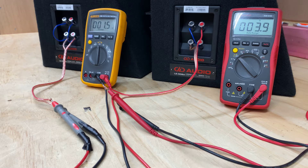I thought it was a handy way to do it so you can actually see how it's wired. Some people have many questions about how to do this, but we really haven't had to worry about it because in the pre-made segment they'd always been wired directly to a 1 ohm load, and you would then go to your installer to change it. So today we've just covered off how to do it. Again, the red multimeter gives you a 4 ohm load, and the yellow multimeter gives you a 1 ohm load.